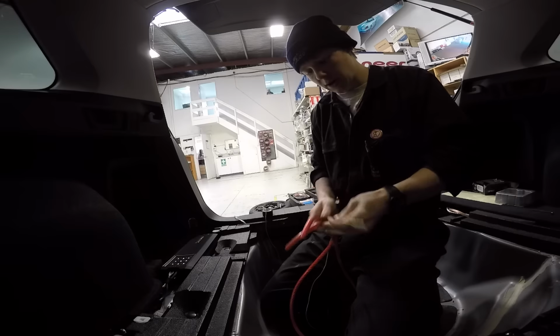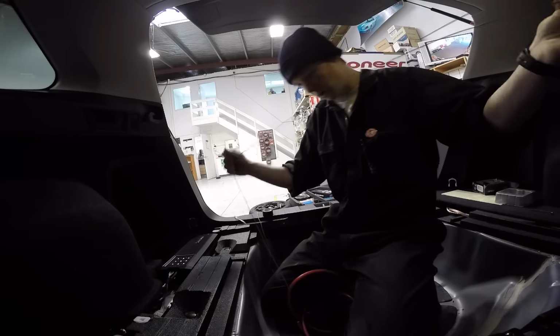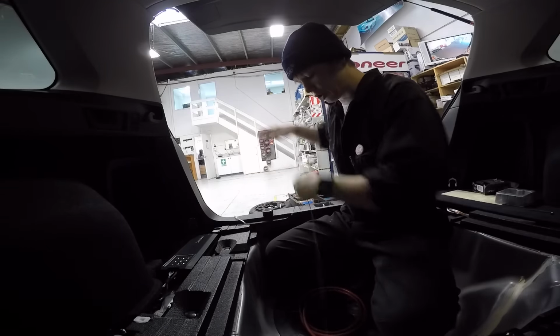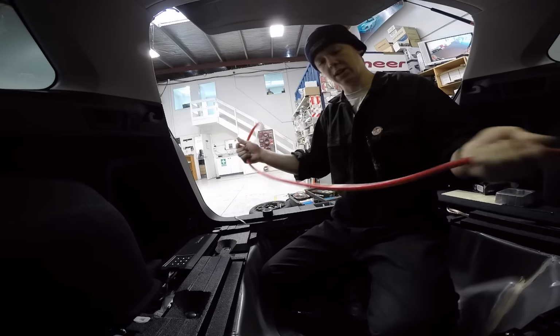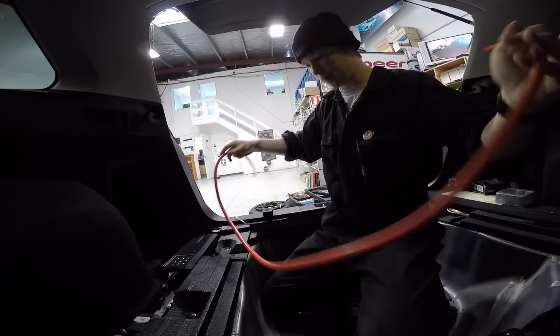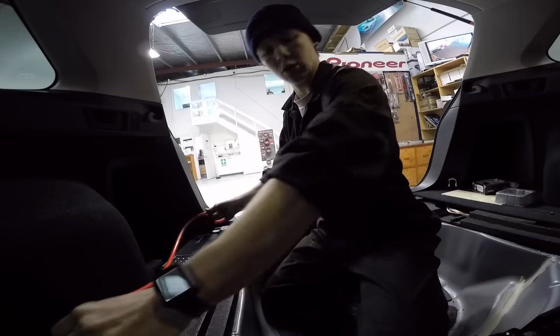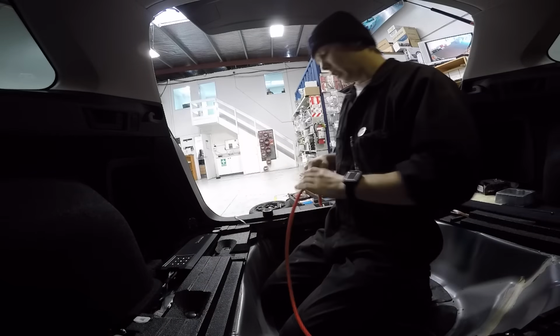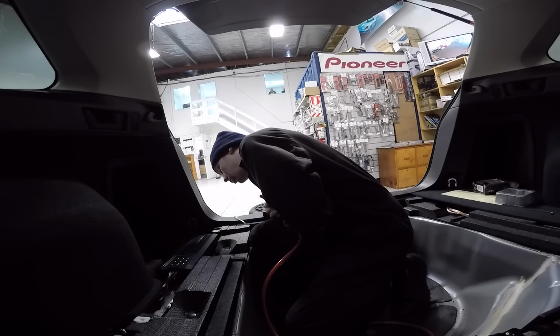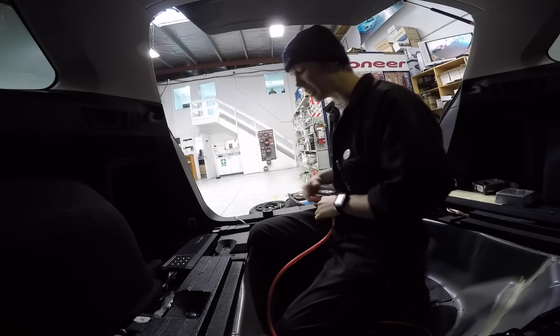That's what I'll do. Okay, so I used my mouse wire thing to sort of measure out the distance to the fuse block, got the length I needed and cut it from some of this really nice high quality Monster Powerflex cable. So this should just loop around. Yep, that'll be enough. So now I have to complete the magic trick of getting this 4 gauge into this power block. And it is a magic trick.